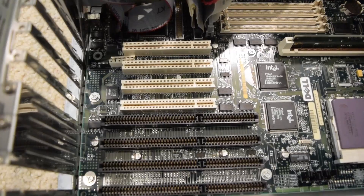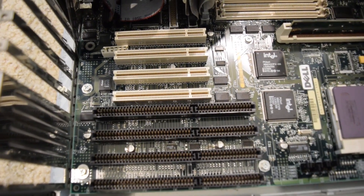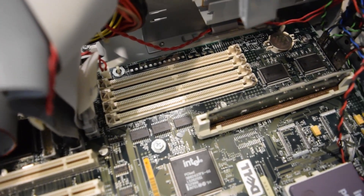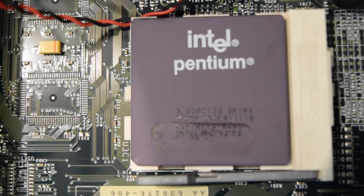On the heat sink they're using some sort of thermal pad — it doesn't look too effective for thermal transfer between the CPU and heat sink. It's starting to rip apart, so I might peel that off and put some legitimate thermal compound on it. Finally you can get a nearly unobstructed view of the motherboard — four PCI slots, four ISA slots, all the RAM slots, a Corsair 256-kilobyte cache module which I could not remove, and the CPU socket which is Socket 5.